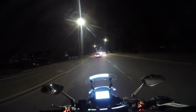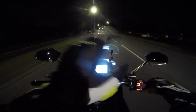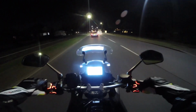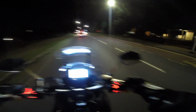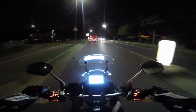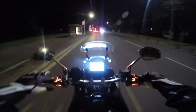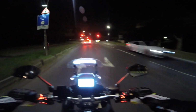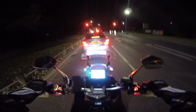Spicy 110, if you ever watch his video, it's good. He shows you how to take a link out quite easily. And yeah, so now I'm down to 40 teeth. I've got lots of backward movement in the wheel, so when the chain slackens, I'll be able to move it back. I've got plenty of play to move it back, which is good.